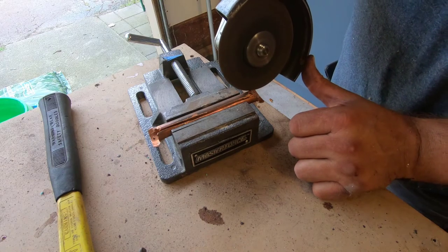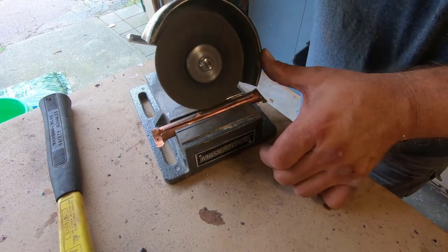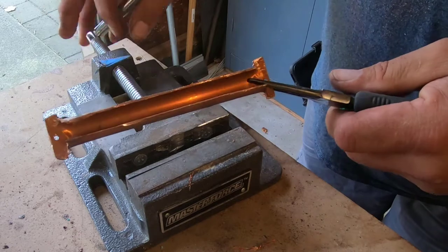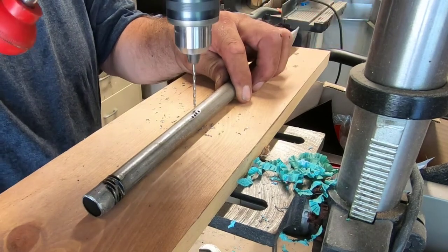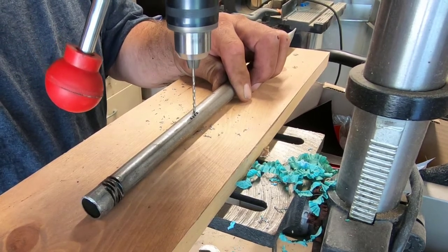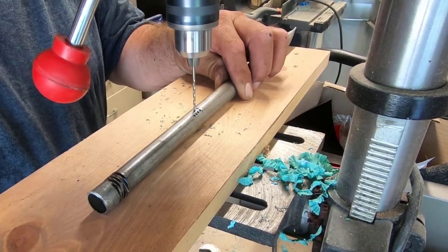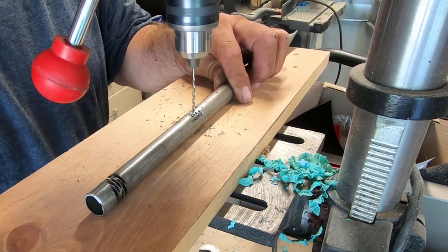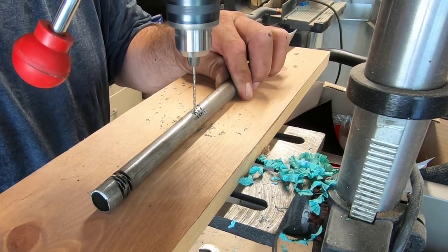After trial and error with the carry-over tubes, the only way I could get this to work was to cut the whole bottom of the tube out. Before I install the carry-over tubes, I took the two new burners out and drilled more holes in the area where the carry-over tubes are. During my trial and error, I realized that there was not enough gas entering the carry-over tubes — that's why I had to drill extra holes. Here you can see what happens to the drill bit when you don't put a flat spot on the round tube: the drill bit walks. I'll do this part on both sides of both of the new tubes.